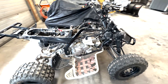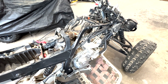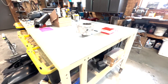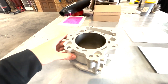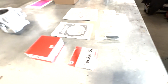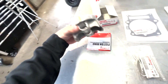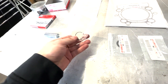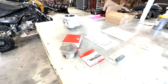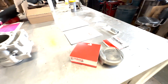Back again with the 2020 Yamaha Raptor 700 rebuild. In the last video, we diagnosed bad scoring in the cylinder, so I looked into a few different options and sent it out to Millennium Technologies. They re-coated it with brand-new Nicosil, which is pretty awesome, and they were pretty quick to get it back to me. I went and got all brand-new OEM parts: new piston, new rings, gaskets, even new clips for the piston. This is our timing chain cover. My plan is to powder coat this cylinder, then start putting everything back together and hopefully she'll be running at the end of the day.